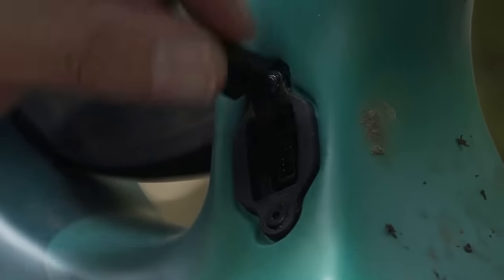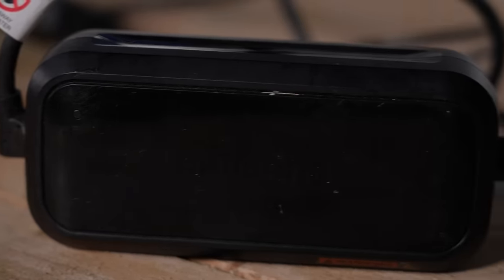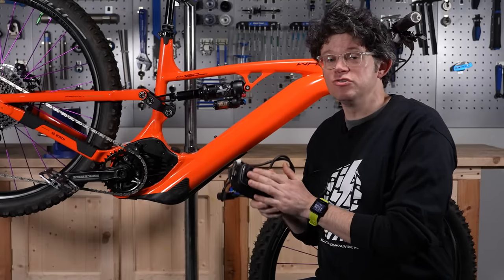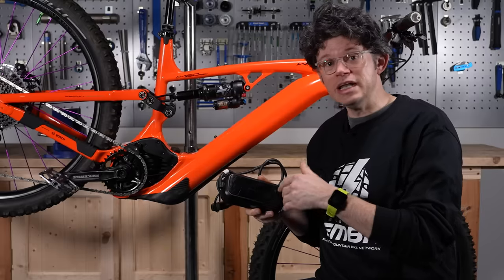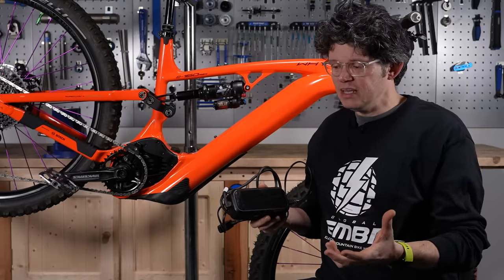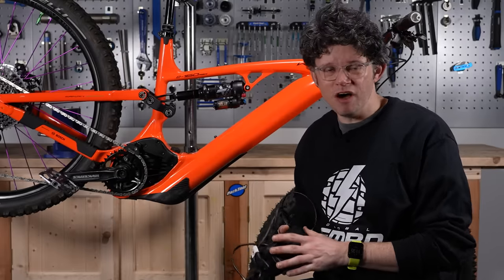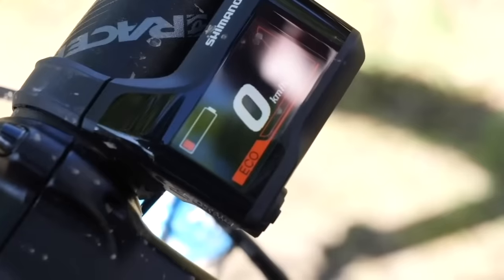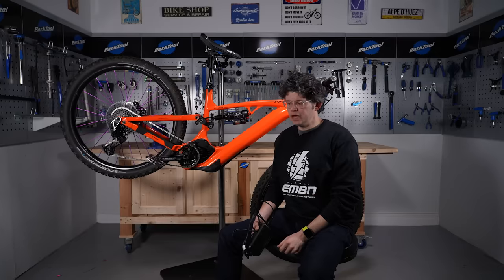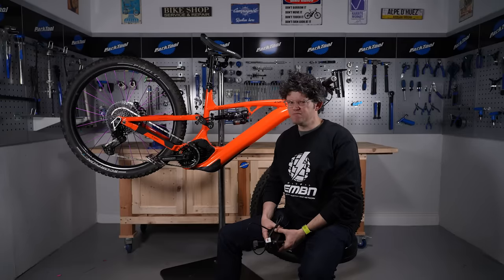Make sure that you use the correct charger for your bike. Most of the brands, whether it be Shimano or Bosch, have smart chargers — meaning they'll help control battery life in a really controlled way, limiting overcharging and controlling heat buildup. That's really key because when things get really hot, especially e-bike batteries, you can get fires, which get expensive really quickly. Also be mindful of not leaving your battery flat for too long — if the battery loses all of its charge, it can mean new battery time.